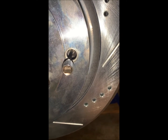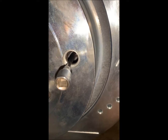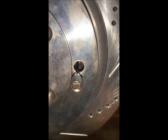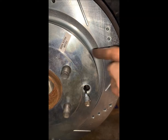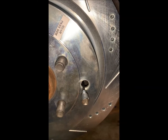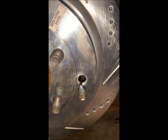So let's finish adjusting the parking brakes. Down in there, that's a 4mm Allen, and that shaft is a 4mm Allen wrench that I've cut the end off of. Then that's a 4mm socket, and I'll go at that with my smallest socket wrench. The instructions say to release that exactly 1/2 of a turn. Then take a rubber mallet and go around the outside and vibrate this. There's an adjuster down there that will settle down to the vibration. Then once you've done that, you retorque it to 6 Newton meters, and that's the trick.